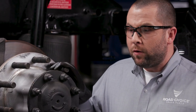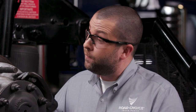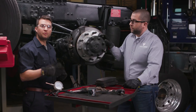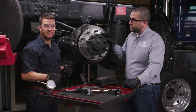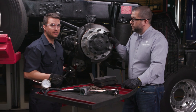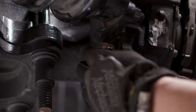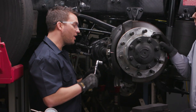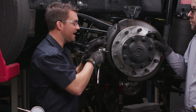From your experience, how long does it usually take to service air disc brakes compared to drum, and do you find it any easier? When we look at the small number of components that must be removed to service disc brakes, it's easy to see that they offer a time and service advantage. First you gain proper clearance between the pads and the rotor with a nut back here, and then it's one additional nut to remove this pad retaining strap and take the pads out.